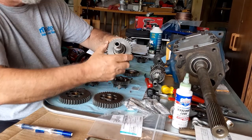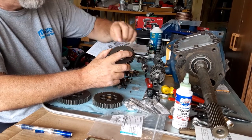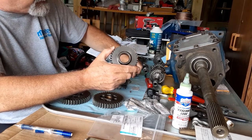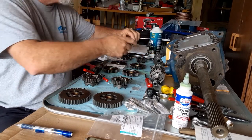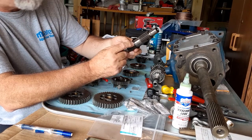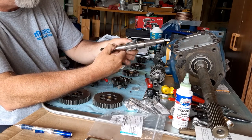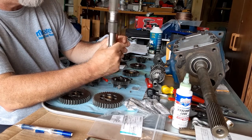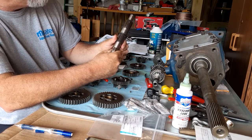The remaining gear also comes off the same direction — it also has a spacer washer in there, just a flat washer, not the star or scalloped style. On the shaft we've got another one of these scalloped washers, but it's captive. This way is blocked by a circlip, so I'm going to go ahead and pull that circlip because in any event, if this shaft gets rebuilt either now or in the future, it's going to need a fresh circlip.